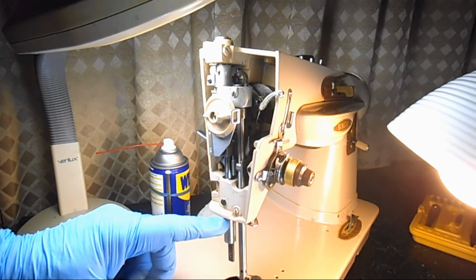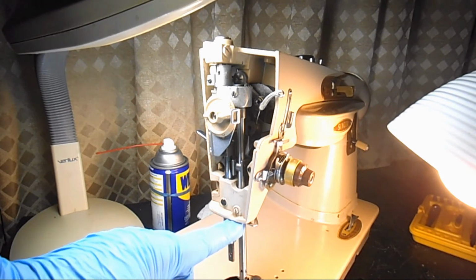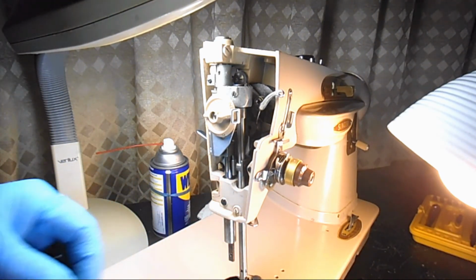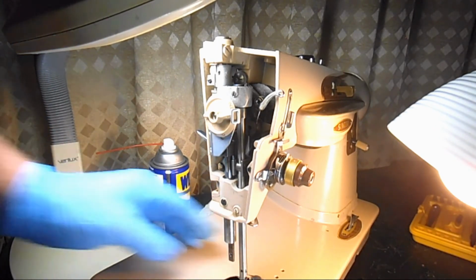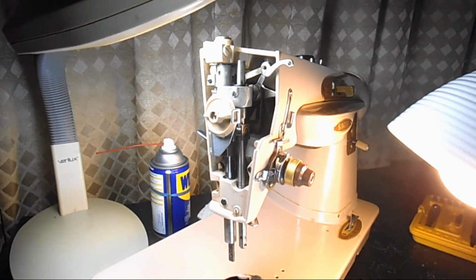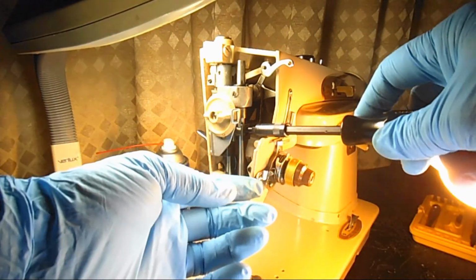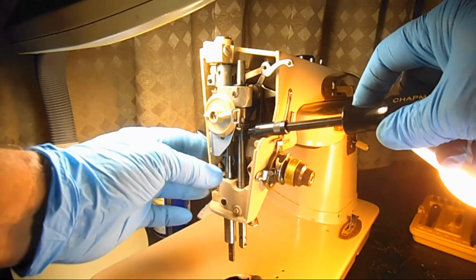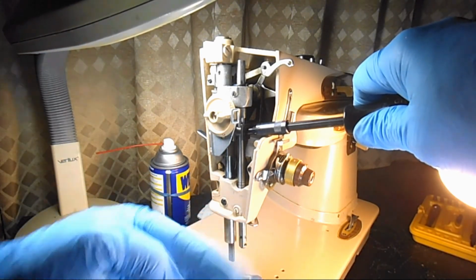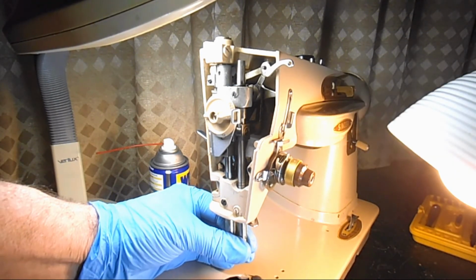And I'm going to go down here again. And, oh, I did a lot better this time. Now that top mark, top band is right just barely below the bushing. Just about to disappear into the bushing. So that's good. I'll come back up to where I can get my good screwdriver on it. This bit is a real tight fit, but that's good because you don't want to strip that set screw. And see if I can get it in there this time. Because now that I've double checked and I've got the right height and I've got this eyeballed pretty good for 90 degrees, then I'm going to tighten that set screw up permanently.